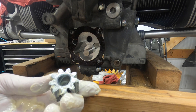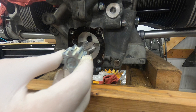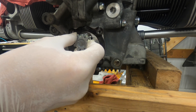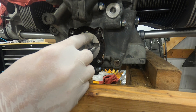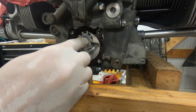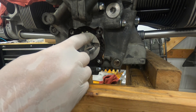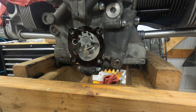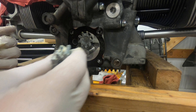Make sure this little dot is facing out when you install the gear. Put the top gear in first and align it with the crank — that'll probably be a lot easier. Also, when it's fully seated, you shouldn't have the gear protruding out — that would be bad. The dot should be facing out.